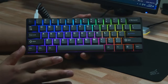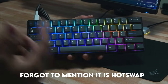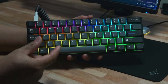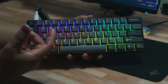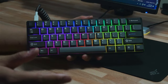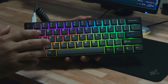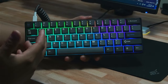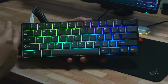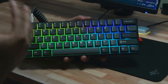These switches don't come lubed out of the box, so if you're a keyboard modder you can lube them, but they are a little bit wider than a standard switch so you'll likely need a new switch opener — I couldn't fit them in any of mine. As for how the keyboard sounds overall, it sounds fine out of the box. They did over-lube the stabs on my unit so they sound decent, but the unlubed switches do kind of kill the really nice sound profile the keyboard could have.